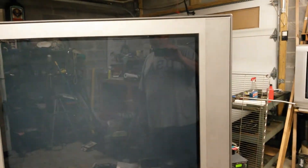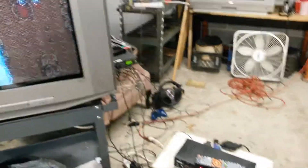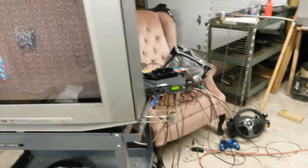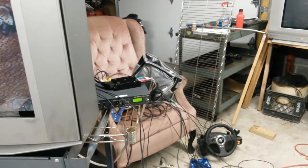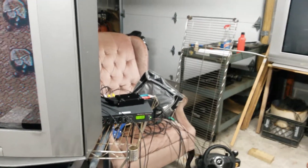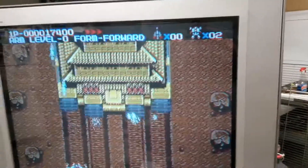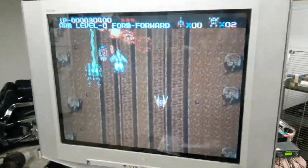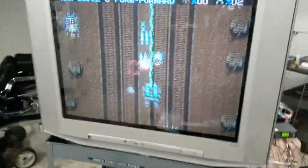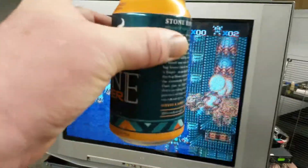So if you want to run 240p into an XBR TV setup like this, just do it this way — it's real simple, and it works. The RXI was also useful because I could move the picture a little bit with the center controls — this TV doesn't have much overscan. Looks like somebody already set this TV up with game settings on everything, so it was ready to go. Anyway folks, thanks for listening, and if you lasted this long through this video, cheers to you!